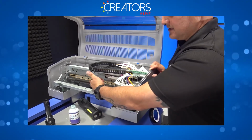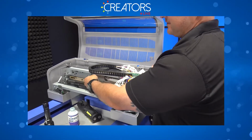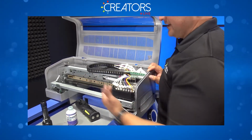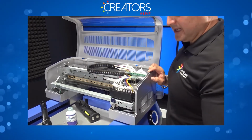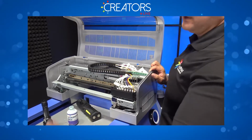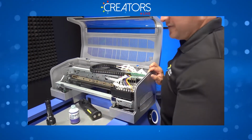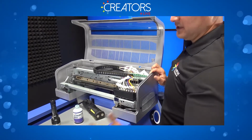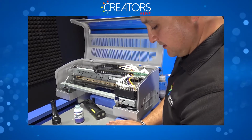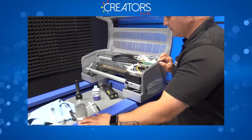If there's a lot of dust or particles or ink, sometimes I have seen drops of ink on this encoder strip, then it will affect the reading and it might error out. So again, depending on your environment, this is how you want to be doing it. If you have too much dust, you might want to do this weekly. If you don't have too much dust in your environment, then you can keep it as a monthly. All right, so let's press function up to move the carriage off the wet cap station.